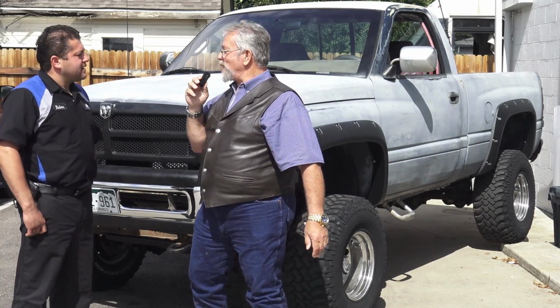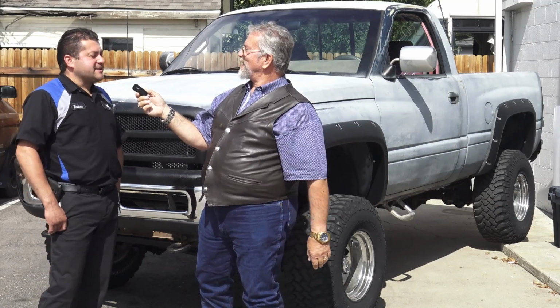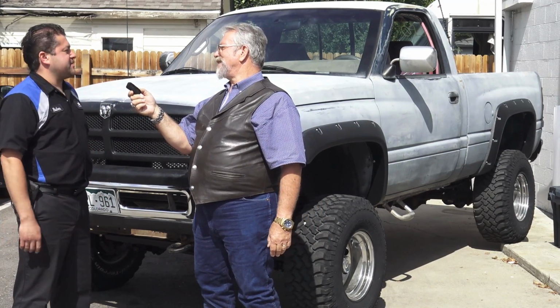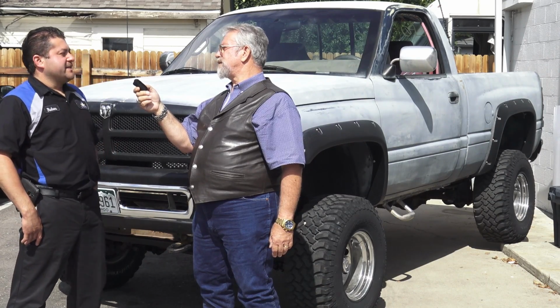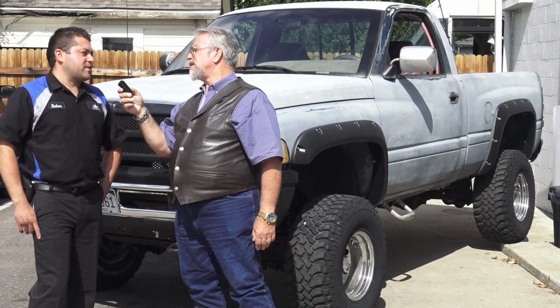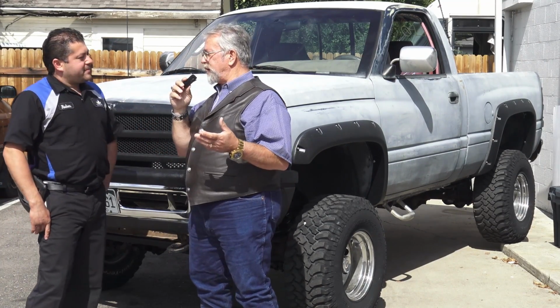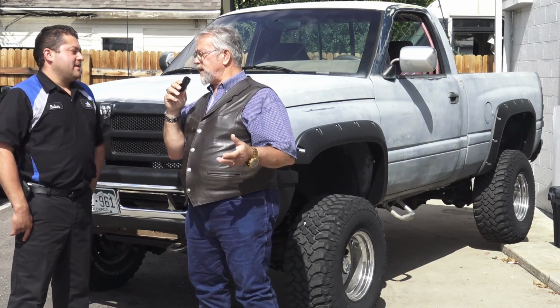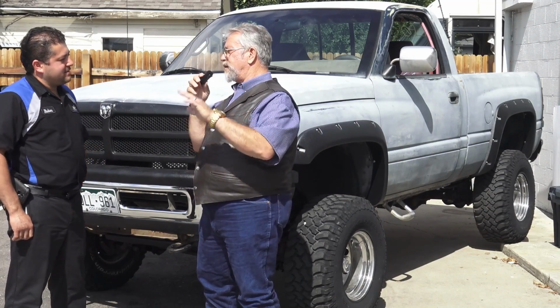Yes. And we're going to try out that transmission, rocking back and forth, and seeing how that reverse works. That's the thing with the Dodges. You got the governor on the back of it, so you can always rock them back and forth and shouldn't have an issue. If it was maybe a GM, you might have a problem up there with the governor snapping off. Oh yeah, I plan on taking the tow rope so I can pull Rusty Boy from Tommy and Roman's Big Green. I'll have to pull them somewhere, back onto a truck or whatever.